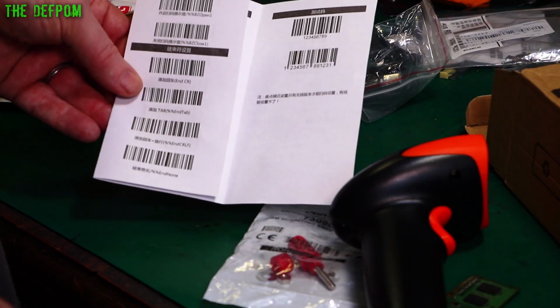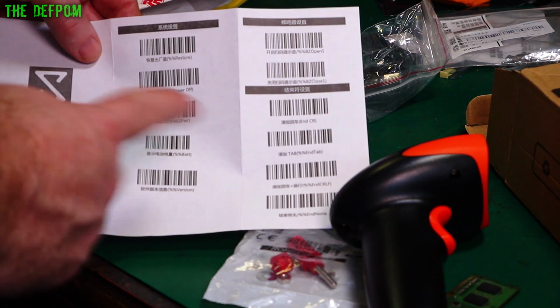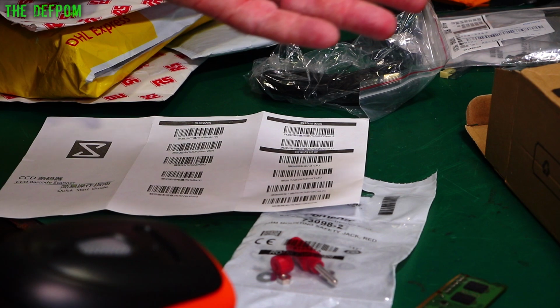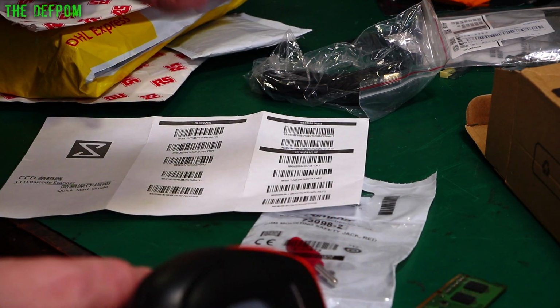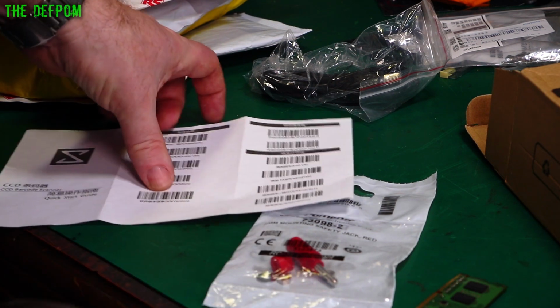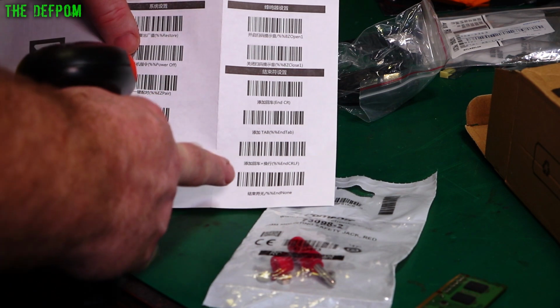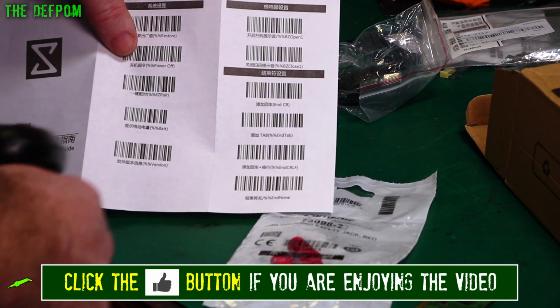Yeah. Okay, I figured out what these are doing now. So these are like options for the scanner. So when I was playing around with this, each time I scanned it, it would be on the same line. Thinking, well, it wasn't doing that before. Before it was doing a new line each time. And you could choose how it does line endings. Ending on a tab, ending on CRLF, ending on CR. So if I do end on tab,